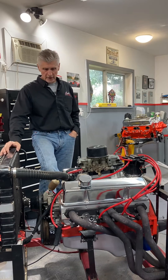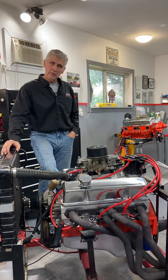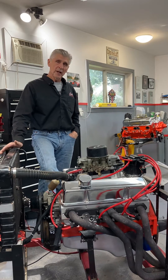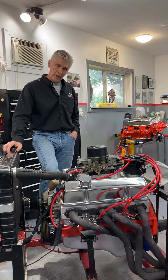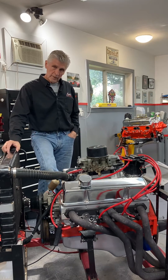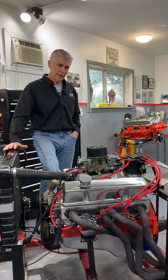I wanted to give Skip White a chance to do the right thing, so I did contact him before I even made that second video. Here's the problem: if I go ahead and take them to a machine shop, or even lap them in myself and fix the problem, I will never know whether that's correct or not - and you will never know. There are lots of videos out there about the fact that you can't take new heads, even though they cost a lot of money, out of the box and put them on without checking them out. If you don't test, you don't know. There are probably lots of heads running around with leaking valves just like mine - all exhaust valves, by the way; none of the intake valves leaked. If you want to see the details, look at that previous video. I demonstrated the valves actually leaking by pouring some brake clean into the exhaust port.